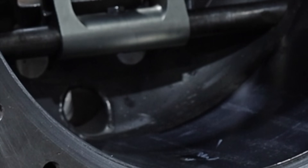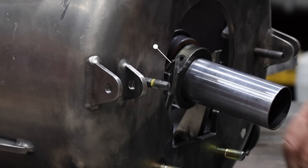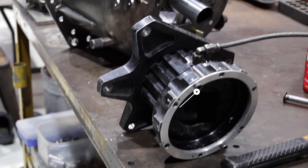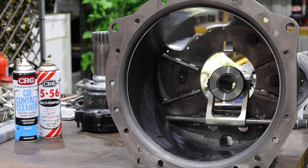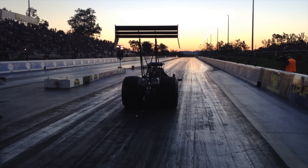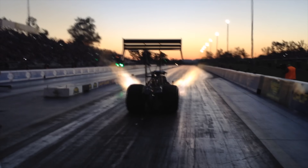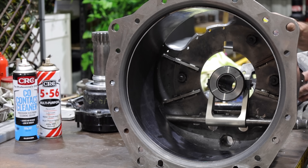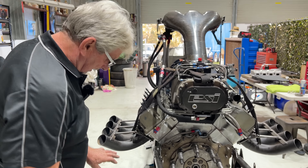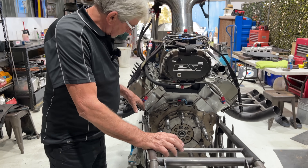You can see our clutch shaft and a spigot bearing that goes forward. This is what we talked about as the clutch cannon — this is how you make the clutch engage. As you retract this hydraulic cylinder, under hydraulic pressure it pushes out, so when you're on the line it is fully forward. Then during the run, under timed circumstances, it retracts back, allowing the clutch to come all the way back and engage all the fingers on the clutch.